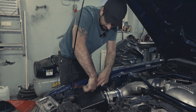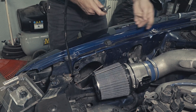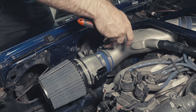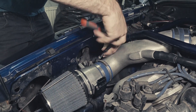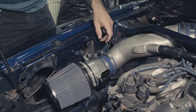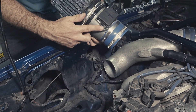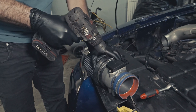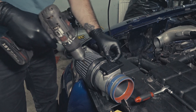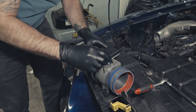Remove the air filter like this and just put it aside. Instead of taking off the whole filter and everything, I'm just going to take off the housing here — I have a 7mm here, just remove that and then remove the other one too. The whole filter assembly comes off like this, and here we see the mass airflow sensor. From here it's easy — just remove the old sensor using whatever tool you have available, and the old one comes out.